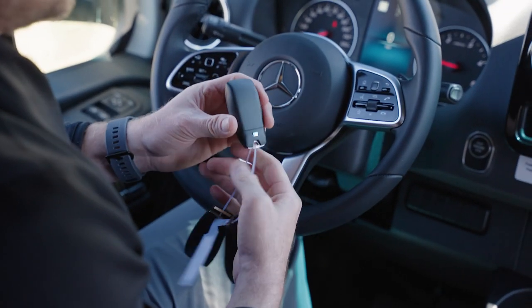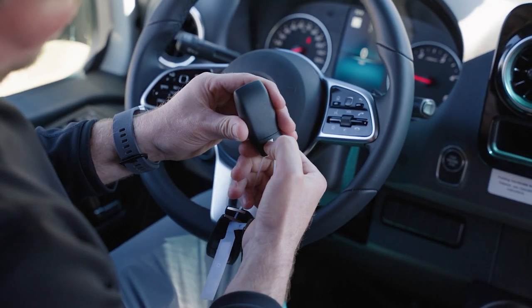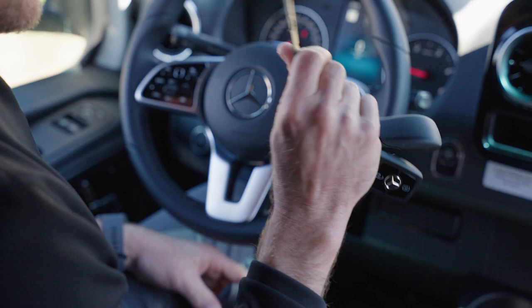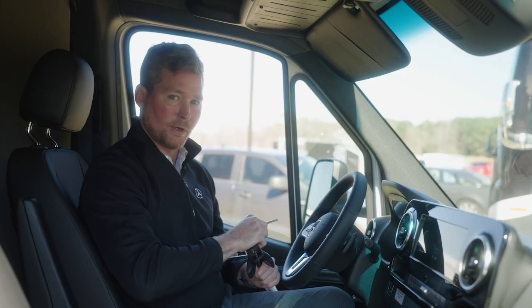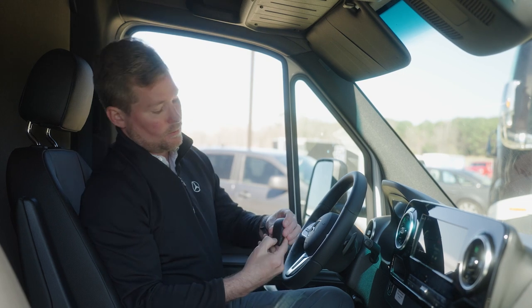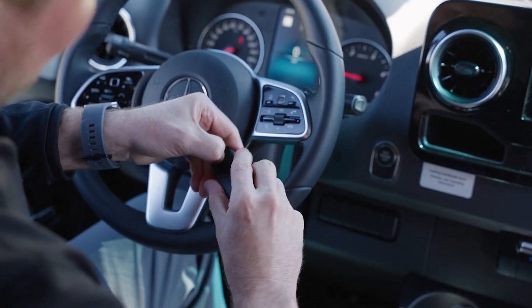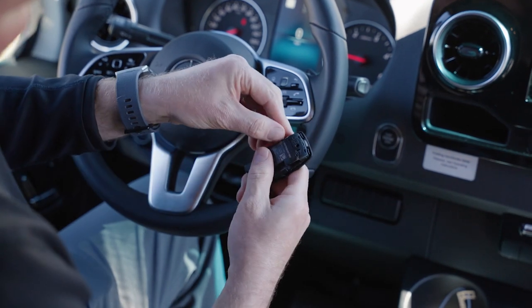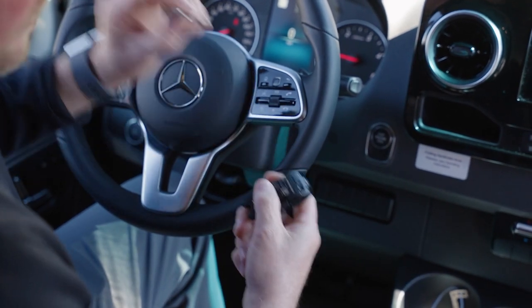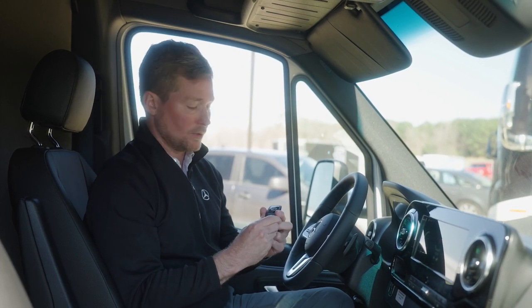Let's dissect the key now. Let's say you do have a dead battery and need access to the coach. You can hit the little chrome button on the back — that's going to remove your bladed key, which you'll insert into the door to get in the coach. We're going to slide the back off the key fob. If we need to replace the battery but don't have one around, I can come down to the spot under the dash, insert this, and I can still crank the vehicle.